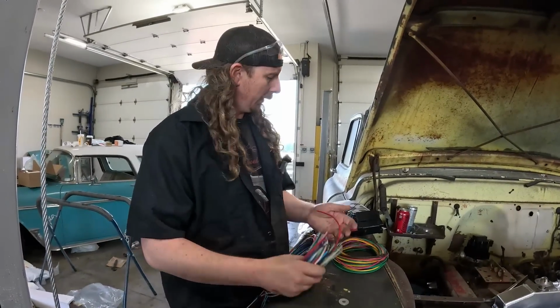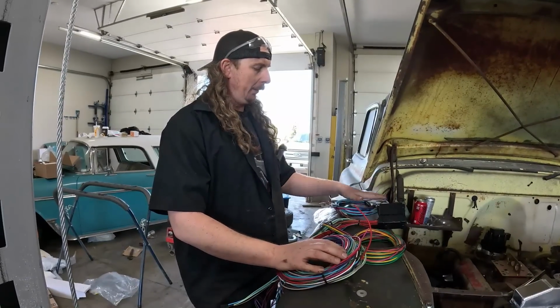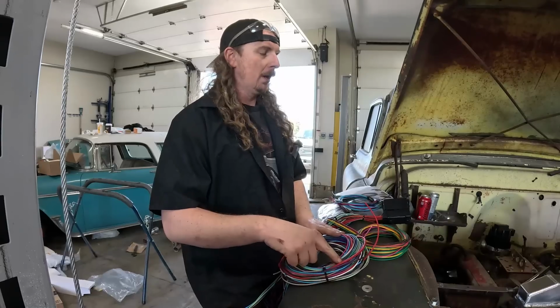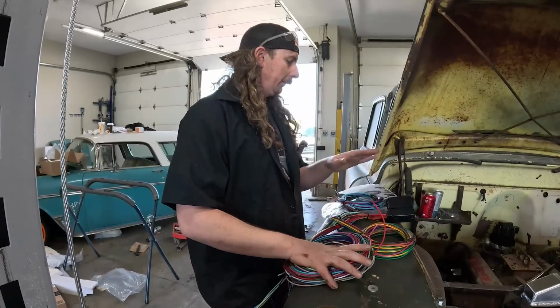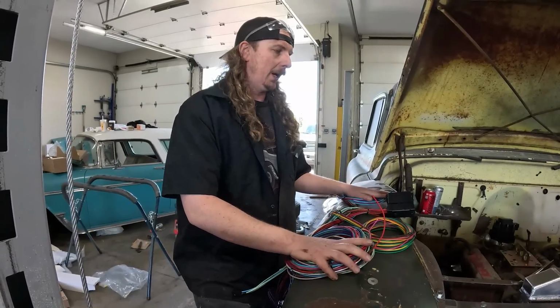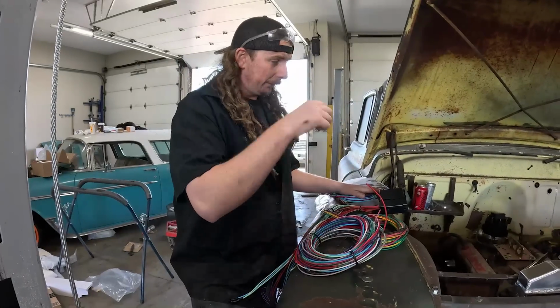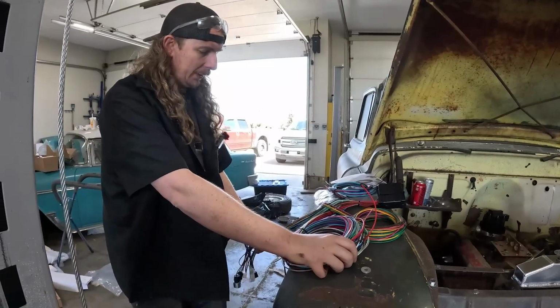And in this as well as this, half these wires are kind of in the cab. So if you have gauges, they'll obviously run here. If you're like water temperature, this will have wipers, all those kinds of things, they'll all run into here. So we'll end up either snipping a lot of those or just leaving them bunched up on the dash because we don't have the options. But in here will also be fan trigger, so there's a few things like that, which would be kind of nice. So I'm just gonna lay this out and see where we end up.